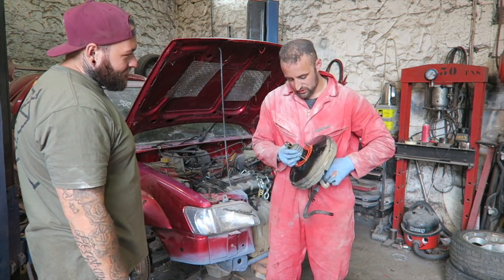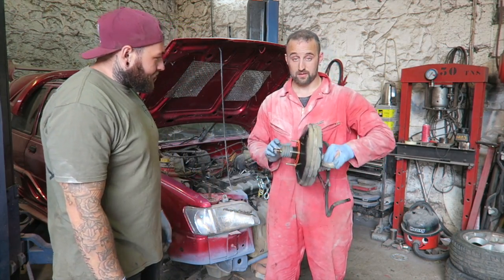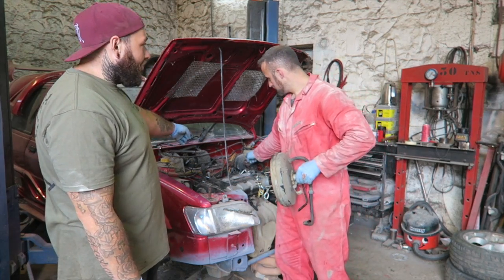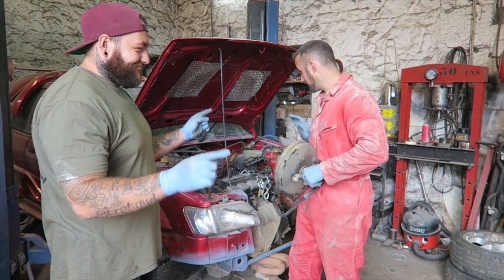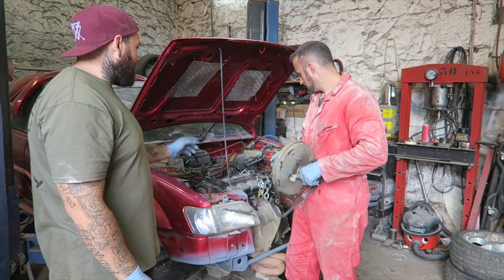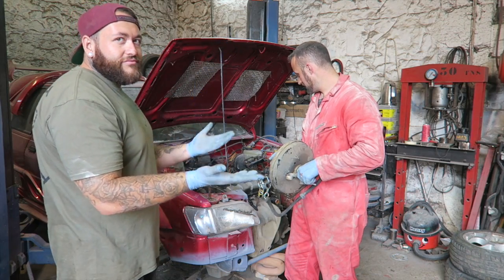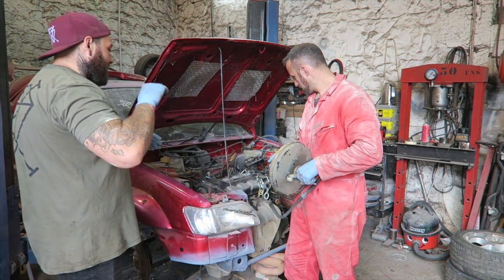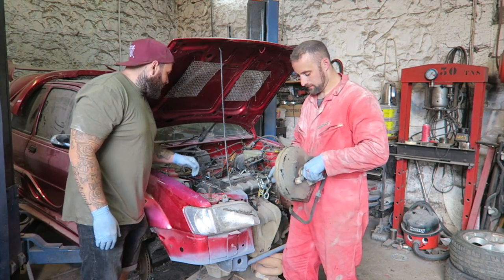In the back of there is a shaft. You press the pedal, there's a pressure. Now, on this one, the Focus one's really short, that one's really long. That one might take the grinder. Shorten the bracket, bring it closer, which will open up the engine bay a bit more, means the engine can come up a bit more. Yeah, we don't want it up much, only as far as we need it to go. Obviously the bonnet's literally there, isn't it? So yeah, we're so close.